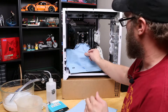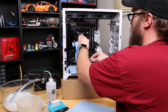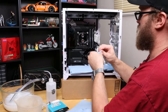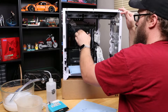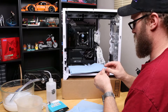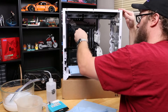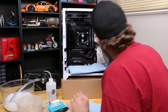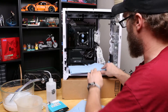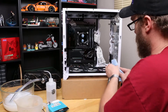Now that we got the tubes out, go ahead and use your paper towels and just kind of shove them in here. We're going to take little bits of paper towels and stick them inside of this little fitting here, so that any water that leaks out goes into the fitting and not onto the actual motherboard itself. Now that we got that all done, up next is getting this motherboard out. I'm going to drain as much of the fluid out of the reservoir as possible so I can get this motherboard out.